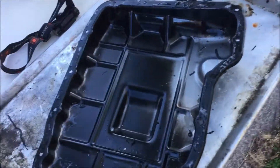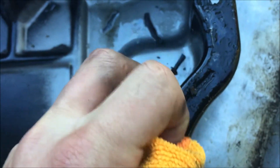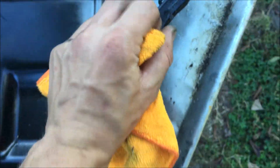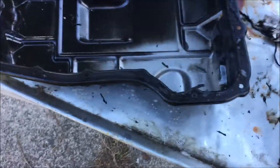I filled up the new filter, put it in — had a little trouble cross-threading it, just like everybody else did who I watched on the internet do this job. When it went in, no problem, we're doing good. The pan's pretty dirty, trying to get it cleaned out. Someone used lots of RTV — my pan doesn't have those divots, I think it does, it's just under all this. I gotta dig all this RTV off — there was no gasket. Got most of that cleaned out, and once this is clean I'll drop the valve body.